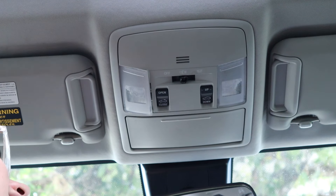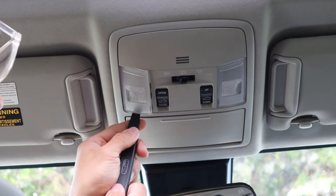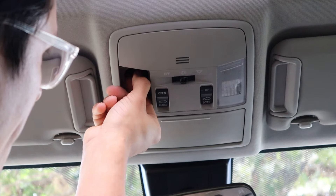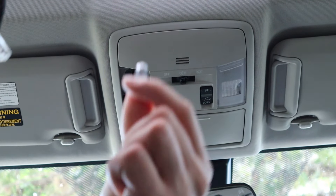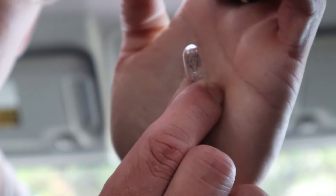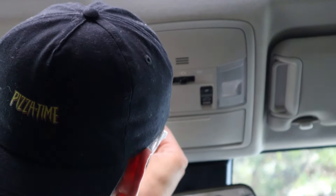I'm not even lying to you guys — it broke. Using the one from Walmart, the HyperTough brand. So really, once you pop it open, the bulb is just right there and all you got to do is pull it straight out. It's pretty hard because I have big hands. You just have to pull it straight down, it might be a little hard. This is the bulb that comes out of the RAV4 — just to show you all what you're upgrading from, this stock light to this one right here. It's pretty common sense — you just have to align that with what you see exactly in there.